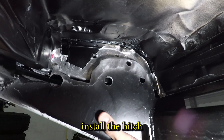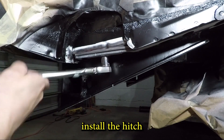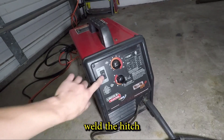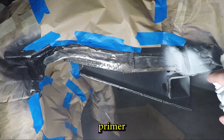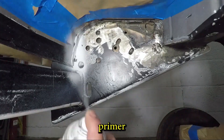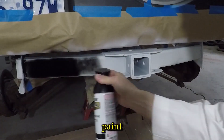This is the final hitch installation — after this there is no going back. With the welder set on high it's time to permanently attach the hitch to the car. After a lot of welding it's time for more paint. I used Rust-Oleum gloss black on the hitch and hammered black on the frame.